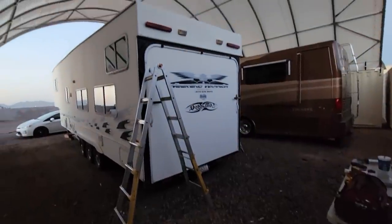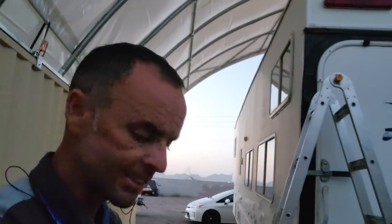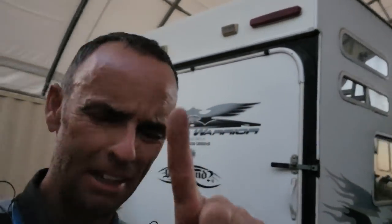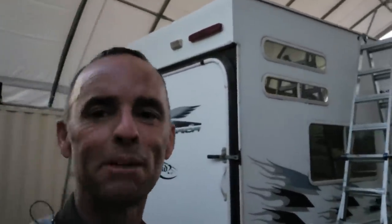It is much later than the sky looks right now on a Friday, but I'm really happy to have this done. But there we are, a much better roof that we did without having to replace the roof membrane itself, and we didn't have to seam it, so there's not a seam right at the very back where you'd have two seams. We kept it down to one seam. And even though this is older TPO material, it was still in really good shape. Definitely way past its 11-year time frame, but still very durable and long-lasting.